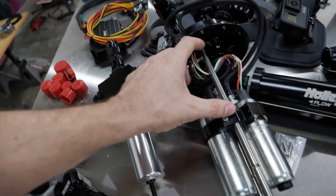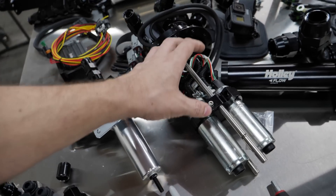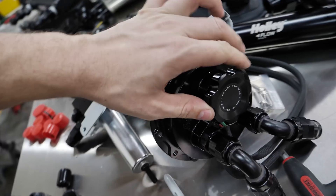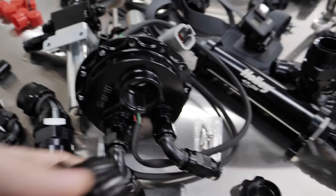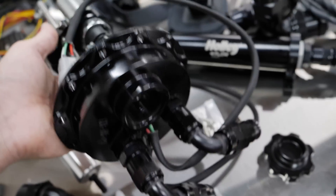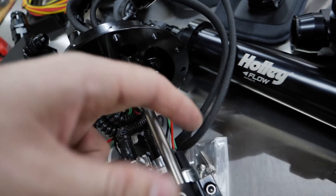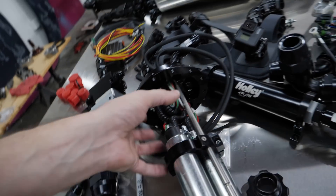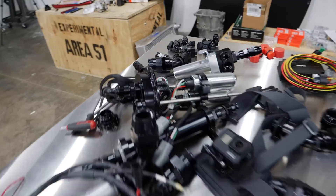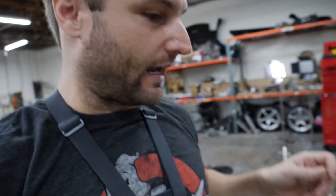Real clean, adjustable. I think it's like 7 inches down to 11.5 for various depths of fuel cells. Also on the top there is a fuel cap — it will fit a line in there instead of just this cap. It is slightly smaller than a 20 AN line. 10 AN in, and then this is an 8 AN return line. What's really interesting — I thought this was advanced engineering — is it does have a little nipple that you can control as you see fit. What I'm going to do between this and the next video is get a 12-point fuel cell, a little baby one — two, three gallons. So right in this area I'm going to put a little baby fuel cell, and the ultimate fuel cell will go in this whole section. Some sort of saddlebag setup. Might as well start there and then use the correct system in its correct spot, so I get the wiring to the correct length. It's meant to party, and I need a system that can party.